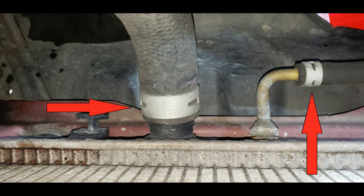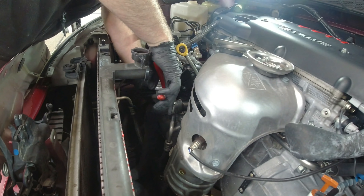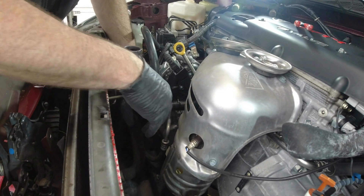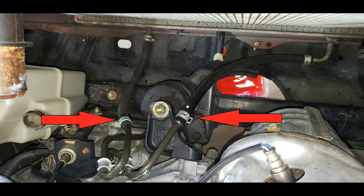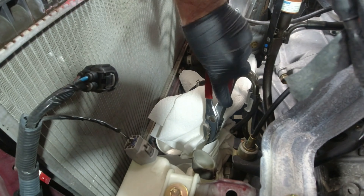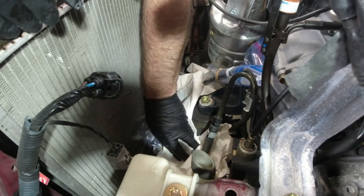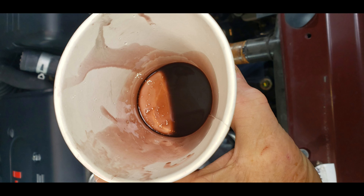Disconnecting the bottom of the radiator: there are three separate hoses to disconnect — this is why we removed the fan, to get access. The hose clamps can only be accessed from the bottom since the factory installed them that way. To avoid removing all the air dams, instead remove the end of the hoses that attaches to the engine, then transfer the hoses to the new radiator on your workbench. Start with the bottom radiator hose — use pliers to remove the clamp, then work the hose off. For the transmission lines, instead of the unaccessible clamps, pull the hoses off higher up. Keep a cup handy to catch any transmission fluid, then bag everything to prevent drips.